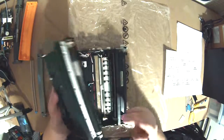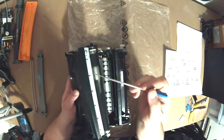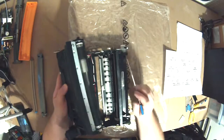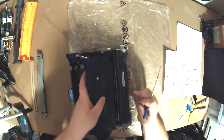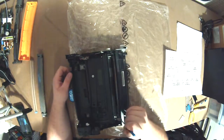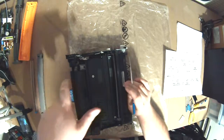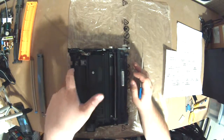So sometimes, like in this case, your imaging problem can start here. You see there's this blank spot. This developer has some kind of obstruction, probably packed-in toner, that is preventing it from evenly coating this roller, to evenly coat the imaging roller or print drum. But this unit snaps in here, and you see these rollers are almost touching. I think they might actually be touching on this model. It varies. Some count on there being enough static charge for it to just leap over. But on this one, the development cartridge goes next to the drum unit, and the actual toner cartridge sits on top.